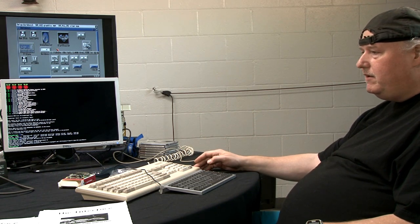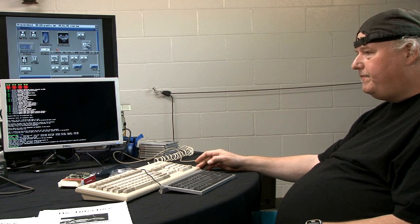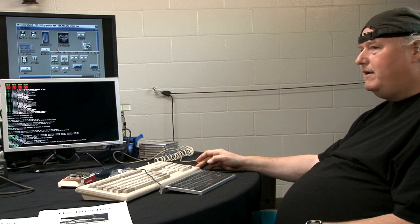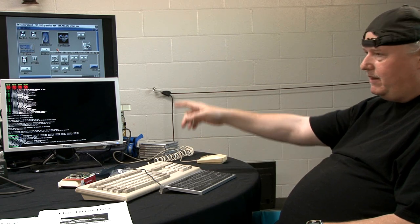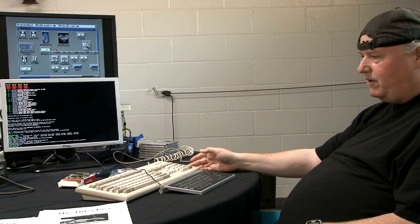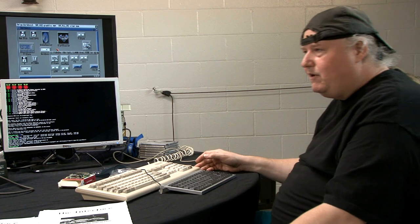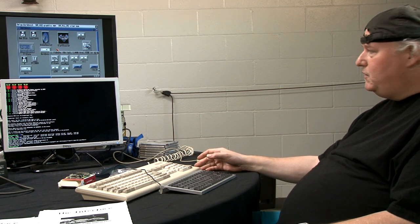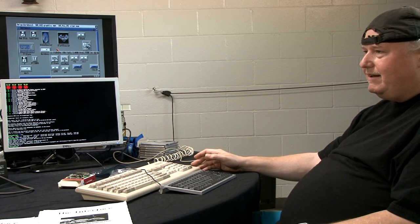But is something like the 020 more stable? I'm not sure. I know that has the FPU stuff and all that when you start enabling 030 and 040. Okay. Enable the FPU stuff, which is good if you got LightWave. Yeah. Not everything uses the FPU. There's only maybe 3D programs. Or if you're running the Mac emulator, which I have on here, but it's unstable. I have a hard time getting it to stay running.